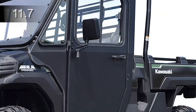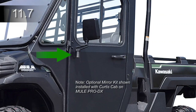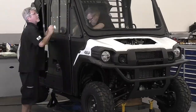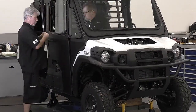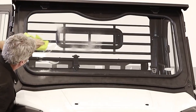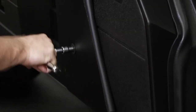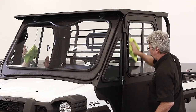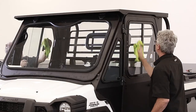If a mirror kit is not being installed, insert plastic plugs into the installation holes. Ensure all doors and windshield close and latch reliably with no visible gaps; readjust if necessary. Remove the protective film from the rear panel and windshield. Double check all bolts, fasteners, and smooth operation of components. Clean up the vehicle and polish all glass for delivery to your customer.